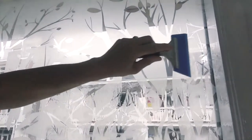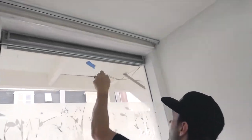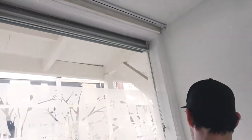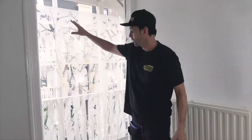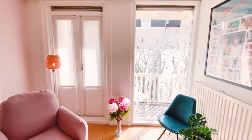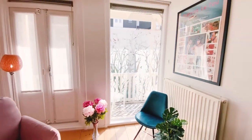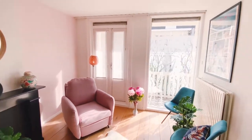Once one half of the panel is done, repeat the exact same steps for the other side, working from the middle out towards the edge. This will force all the moisture out from underneath the panel. For post-install steps: go over all the edges with a highly absorbent paper towel to soak up any moisture, then do a thorough 360-degree check on all edges and the main surface area to look for bubbles. If you're going to reinstall the silicone, be sure to wait one or two days. And remember, this is what the window looked like before — with the curtain permanently drawn, no light and no design factor — compared to now. The window has a beautiful design that works really well with the rest of the Wrap Rejuvenation. It lets in a lot of light while maintaining privacy, all thanks to an easy, straightforward install using tips and tricks from the Wrap Institute and window filming tools from CoverStyle and SolarScreen.